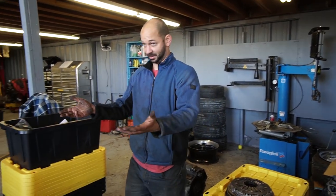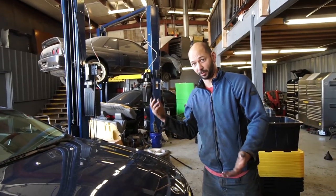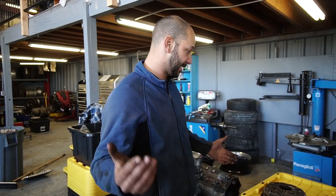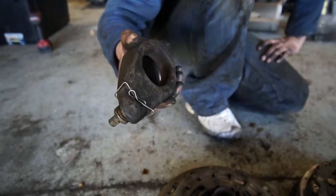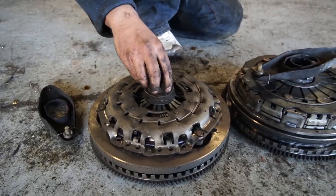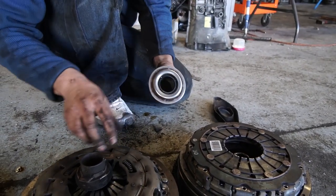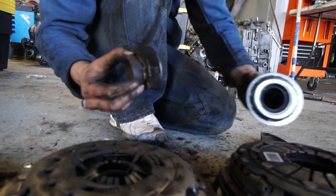This is not a car with an S85 in it — this is an N62 4.4-liter. They do share transmission and bell housing architecture. I can't find any info on anybody trying this on the internet at all, so I'm going to see if it works. Here's the shift fork from the current six-speed with the throw-out bearing, and the shift fork and throw-out bearing from the M5 — you can see how they're substantially different.